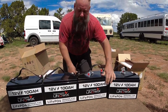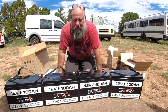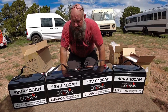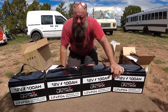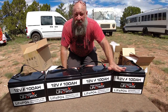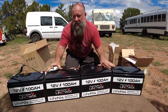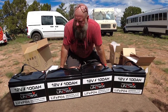With these four batteries I'm excited to upgrade, because 200 amp hours is kind of minimal for my needs. Three days of cloudy weather and I start running low on power. This is going to extend my life out to five or six days if I have rainy cloudy days and I'm not able to charge the batteries. With this kind of power you're talking about being able to run a small AC for a short time — you could definitely cool the truck off. If I added maybe two more batteries, now you're talking about running all through the night — a total of six batteries.